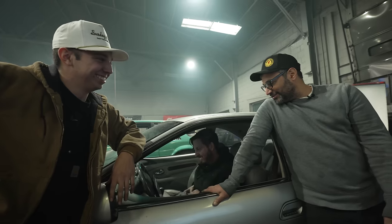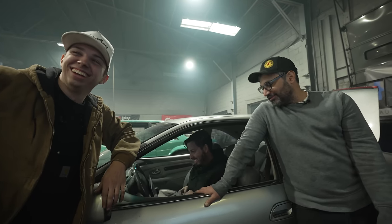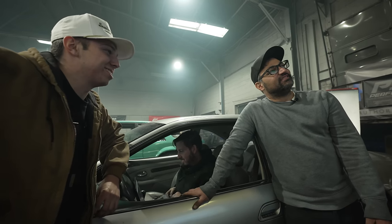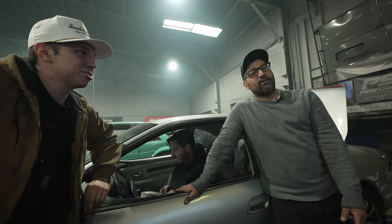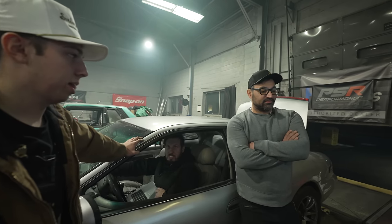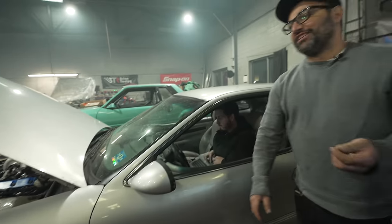You want to put a degree or two of timing in it, or what? Let's see what it does. We'll run the same run with a degree in it. Just one more. Okay. Dude, what goes down must come up, I think is what they say. Let's do one more degree. All right, put in two. I like that guy. We're out of injector. We're going to add a little timing.